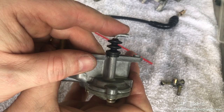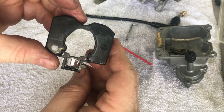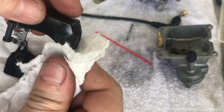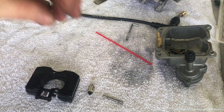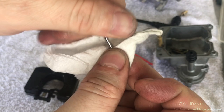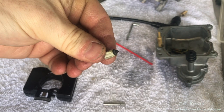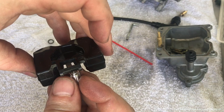Removing the components stored with the float — I have no reason to believe the float isn't liquid tight, though I could store it under liquid to check. Being careful not to bend the tang that sets float height, I'm just going to clean it with some carb cleaner to remove residue — it doesn't require much else in this condition. The float pin was difficult to remove and has buildup, so I'll use metal polish and check it with my nail to make sure there's no raised metal. The float needle is also part of the rebuild kit so it won't be reused — snapping the new retainer onto the needle and sliding it back in.